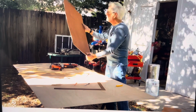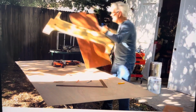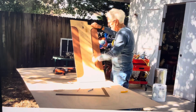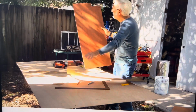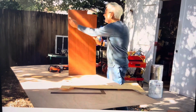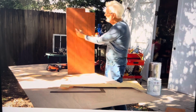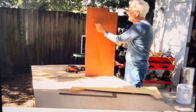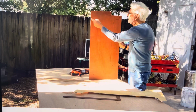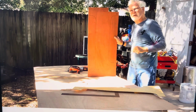All right. Now, I cheated a little bit because I took my pattern and measured for this cutout. But what you'll do is you'll pop that into place. You may have to make one or two, but you're going to follow the edge of the window on the outside. Remember I told you you had a 2-inch piece in here, plastic. Well, this would have been back here. So the pattern's going to cover what that 2-inch piece covered and what this panel covered.